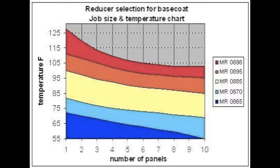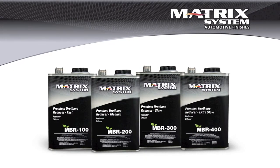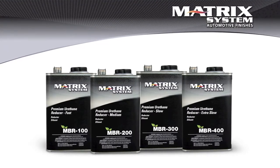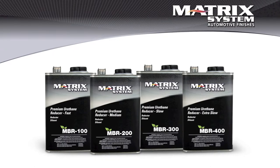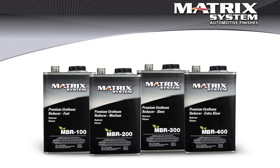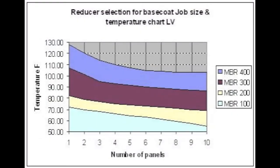Then again, on the other side of the spectrum, a really fast thing like a rear view mirror or maybe a bumper off a car, you can go ahead and use a faster solvent at a little bit higher temperature than the range would indicate, because you're still only going to be spraying for about a minute or so, and it'll have the opportunity to orient properly and smooth out. All the same things are true with the low VOC areas, except this time we're going to be using the MBR reducers — that would be 100 through 400 — and they're roughly the same distance apart as the MR reducers for higher VOC areas. However, there's only four of them, so the range is going to be slightly different.